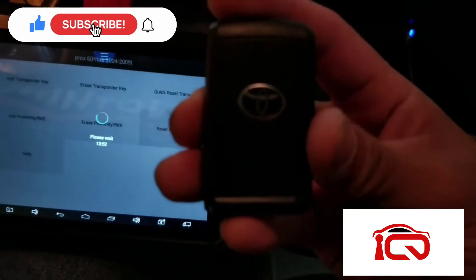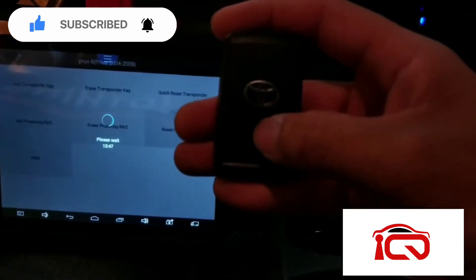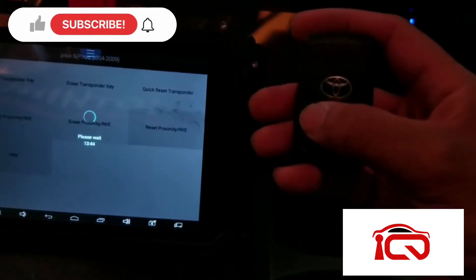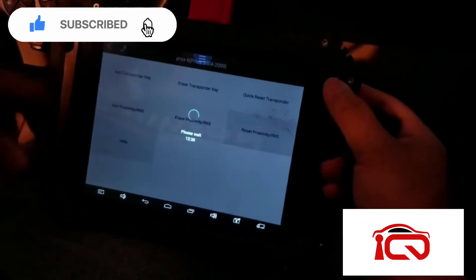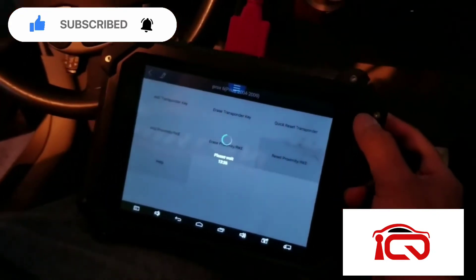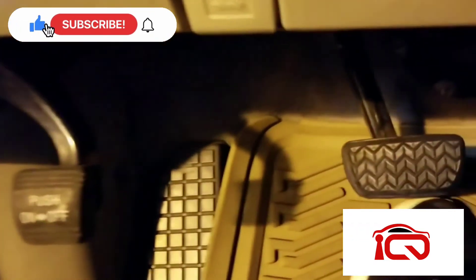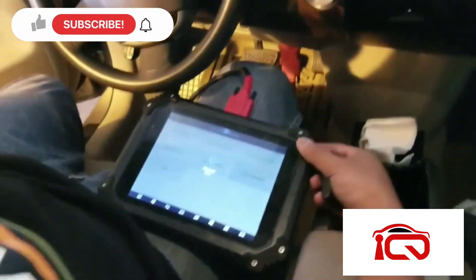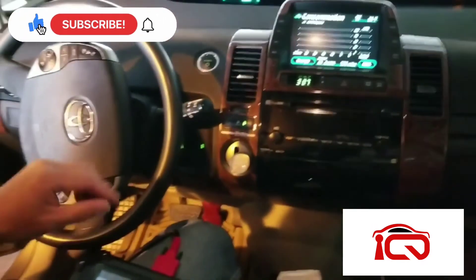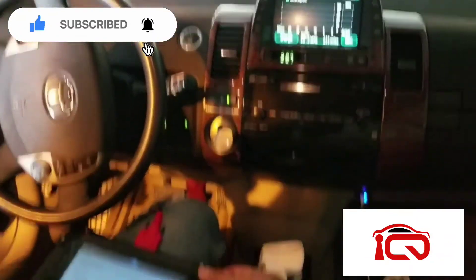Usually this logo, instead of silver or chrome, will be black all around. And on the car itself, if you want to know if it is smart access, there are two distinctions. One is on the driver's door handle and the passenger door handle — there'll be a rubber button on the handle, which usually means it is a smart access. Also, in the bottom of the driver's door dashboard, there is a button that says 'key' next to the tire pressure light. That is a smart access button that will disable the proximity feature so it will only work in the slot. Pushing it out means it has smart access; pushing it in disables it to do only non-smart.